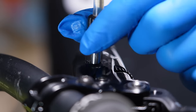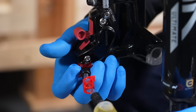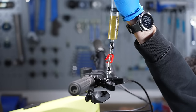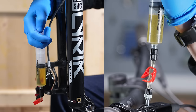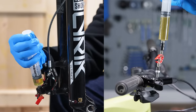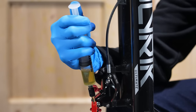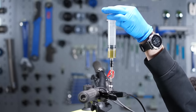With the syringe and fluid prepped, it's time to insert it into the lever — it's okay to let that one dangle whilst we add the syringe to the caliper below. With the bleeding edge port screwed in and opened in place, open the little clips of both syringes. Make sure the top lever syringe is vertical, then apply even pressure and push through the fresh brake fluid. Be mindful not to empty either syringe completely — work by pushing fluid up into the lever and then using a vacuum pull to pull it back down through the caliper.